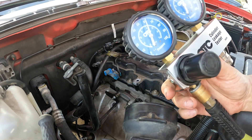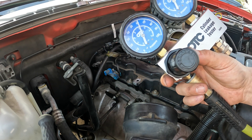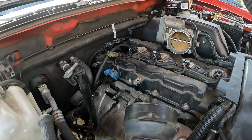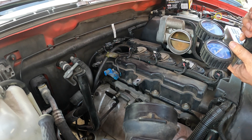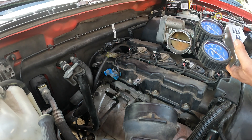Just so you all know, a good one will have the same pressure on both sides. As I got the hose off you're expected to see some loss, but this was only holding 10 pounds of pressure when the other one was at 60, and it's coming through the throttle body really well.